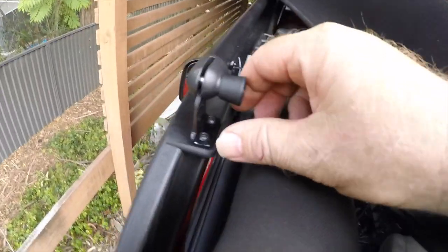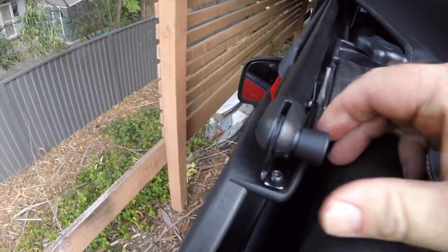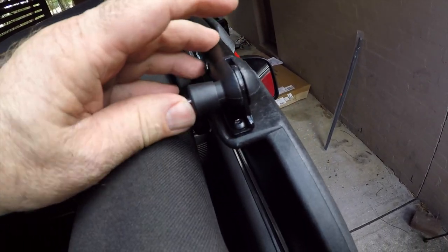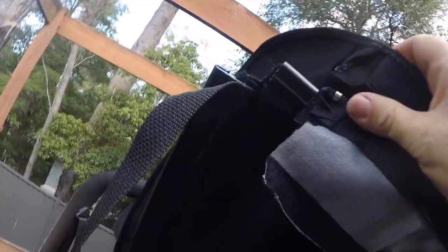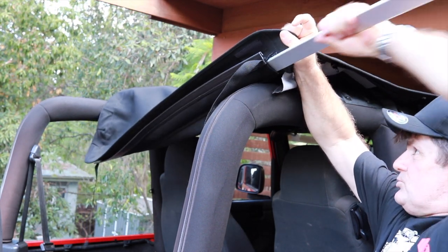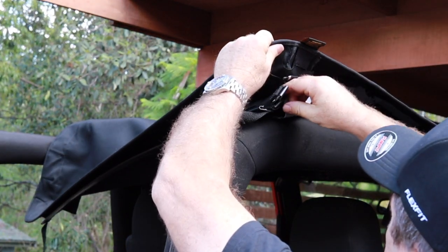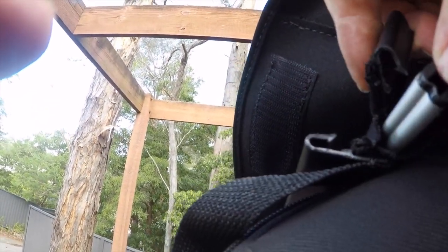After laying the roof over the top of the vehicle, these pins can be put in — just pull those out, slide them down, drop them. We also have a rear bow that has to be inserted just above the back window through that pocket. Once pushed through, you have to put this clip over the end, then go to the other side and attach it — push that back and attach the same.